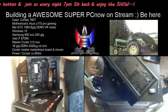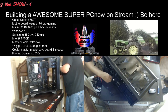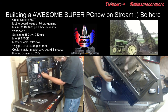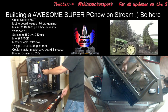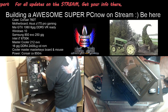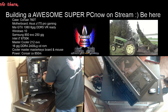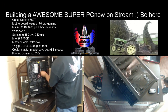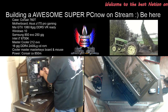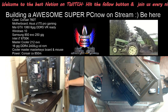Hold that a second. So we're going to come in with all these wires right here. You want me to come around? No, up here. Okay. Now we have it going in one direction. So when you bring this through, you want to bend this wire so that you can put it into your USB 3 slot, which is right here. Put your fingers under the motherboard and support it. And there you go.